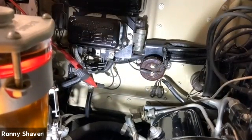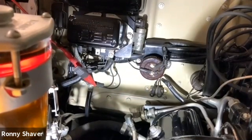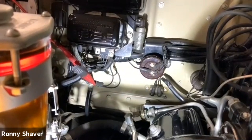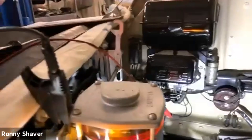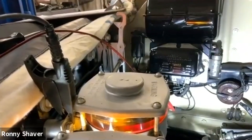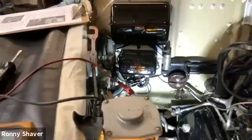I think we ground the other lead. It shows a nice little picture with a cool looking old analog voltmeter. So we'll look at the ground, put it on volts. And it says do not exceed an approximate generator speed of 1000 RPM. So we have to start up the car and watch the voltage.